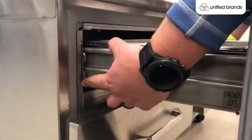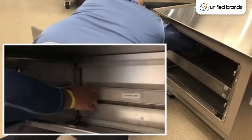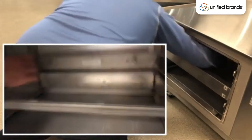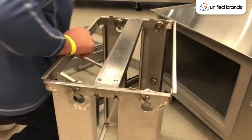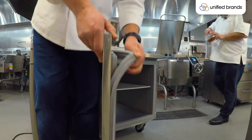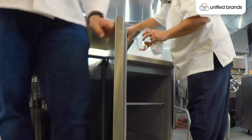All three of these items are designed so you can fully remove them without tools, making it much easier for anyone to do that at any time. The door cartridges are removed with simple pins on the cartridge itself as well as some thumb screws. The covers are either removable by lifting them off or using those same thumb screw assemblies. The gaskets on the doors and drawers are press fit and removable without tools, and can also be reinstalled without tools.